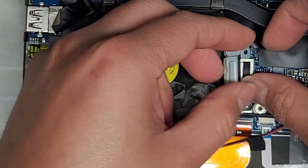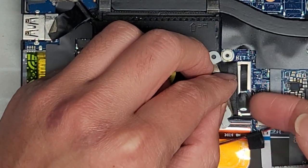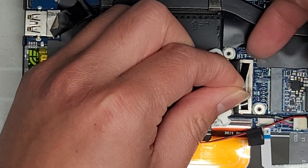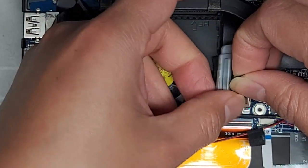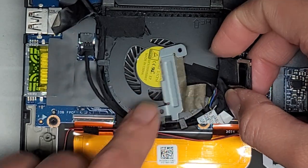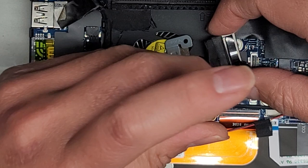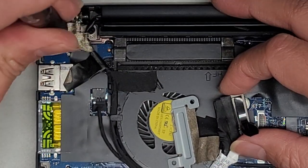You do want to press and hold the power button after disconnecting the battery if you're going to do this. Then we're going to disconnect the LCD LVDS connector here — lift that up. You can use this as a pull tab. If it doesn't come out easily, you can get underneath and pry it up. So we got this out — we're going to peel this cover off because we're going to need that for the other screen. And we're going to undo this screw down here — we need a JIS0 screwdriver for that.